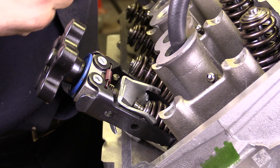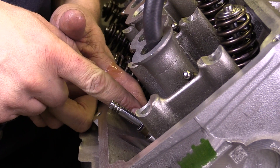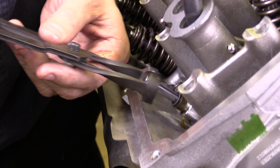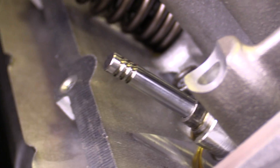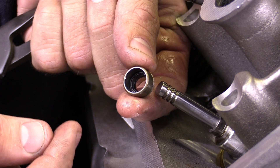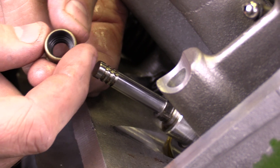I've removed my keepers from the engine, and now I can go ahead and pull my valve assembly up. This is what we're talking about — this is the valve guide seal or valve stem seal. Notice that my valve is not going down into my cylinder head because of the air that's in there. There are several different valve stem or valve guide seal tools that remove it. Here's a particular design — I simply grasp on there with a little rotation, and then I can remove the valve guide seal. Now there are several different designs of these; some won't require any tools to remove, but all of them do require removal of the spring itself. Once I've pulled this out and replaced it, hopefully there won't be any more oil leaking down into the combustion chamber and burning.